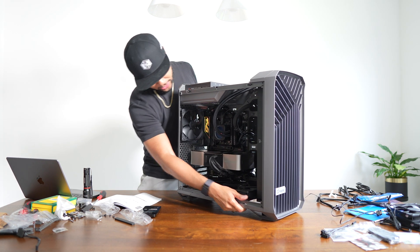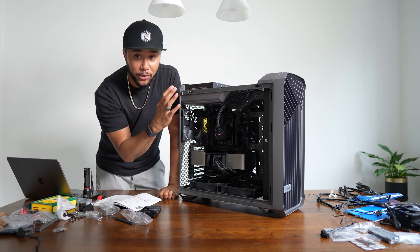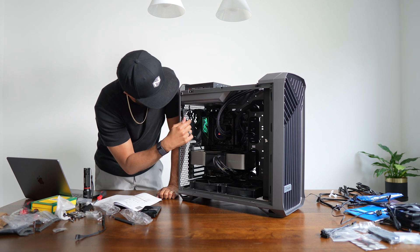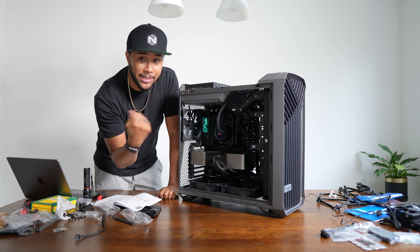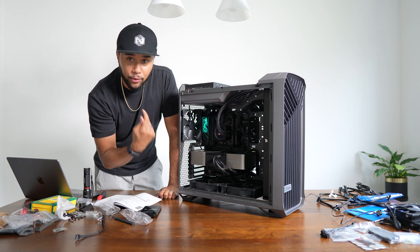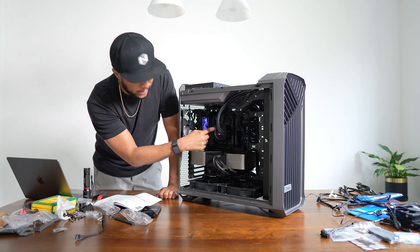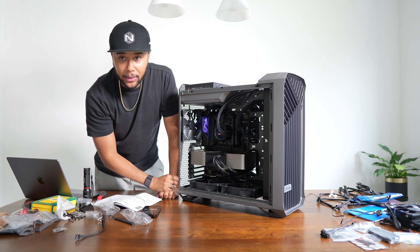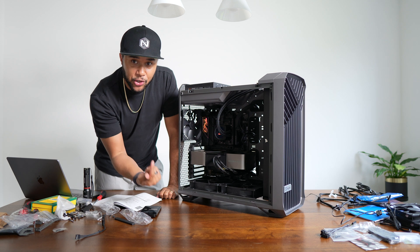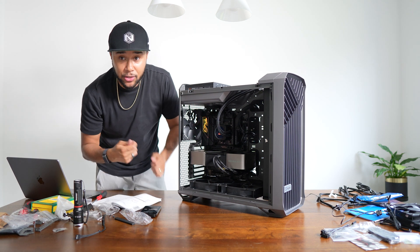I'm going to move things here because now we have the RTX and it's really heavy. It turns out on the PSU there's a bunch of different cables. I plugged the VGA cable into the CPU motherboard socket instead of the CPU cable. I thought everything was connected because the connectors are the same and I couldn't find exactly what the problem was — I thought maybe it was the fans, or maybe the power supply unit was damaged. Eventually I found that on the label it said VGA — I had to actually look with the trusty old flashlight. I just swapped the cables and it worked.